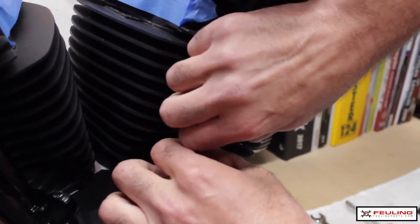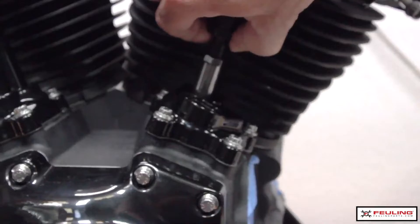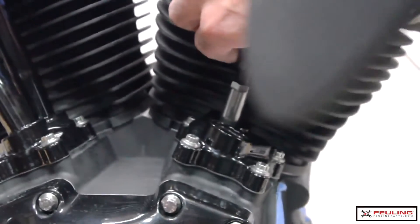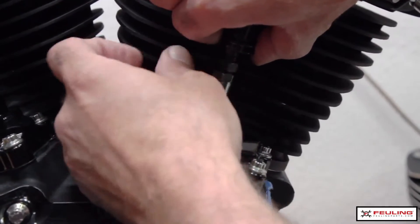I'm going to compress the spring of the pushrod tube. We've got our pushrod base down on top of the lifter. We're close to zero lash. I want to get the jam nut into position, so now I'm going to thread that down.